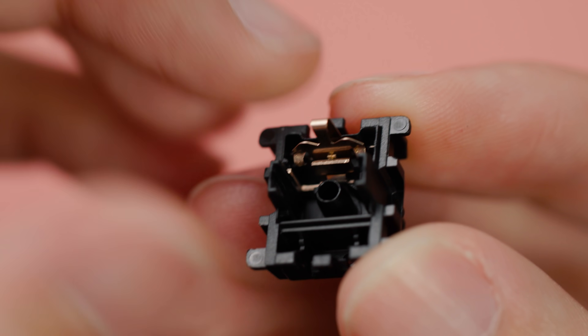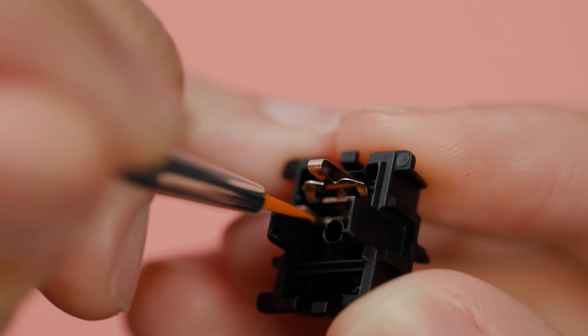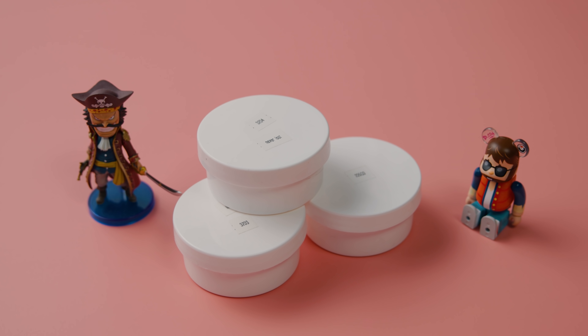At this point, there's probably some slight residual lube throughout the entire tip of your brush. I like to use whatever is left over and apply a thin coating on the two bumps on the leaf. When you learn about lubing switches, you'll often hear people recommend that for linear switches you should lube the leaf and/or stem legs, and that for tactile switches you shouldn't. I both agree and disagree with this advice. For linear switches, yes, you should 100% apply lube to either, if not both, the switch stem legs and the leaf. Many people advise against doing the same for tactiles — the biggest reason being that many new enthusiasts will tend to over-lube these points, which can reduce the tactility of tactile switches drastically. Especially with the thicker Krytox and Tribosys lubes being very popular nowadays, it's very easy to over-lube the leaf and potentially turn your tactile switches into essentially a linear switch. Lubing these areas can lead to smoother tactiles at the expense of some tactility, but little to none if done right.